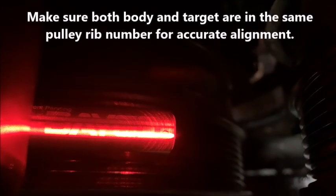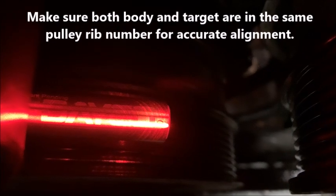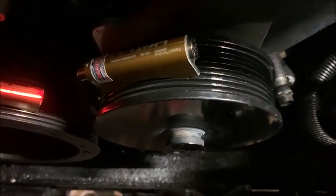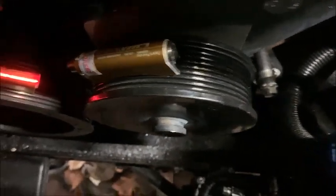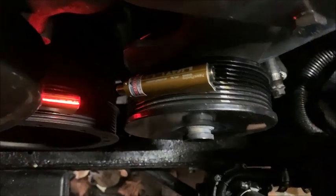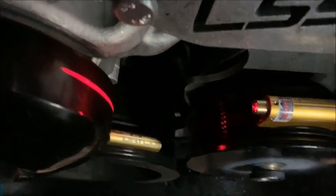You've got the body shining on the target — you can see that groove in the middle of the target. That's what you want to strive for: get that laser right in the center, and then you'll know the balancer and the steering pump pulley are in alignment. Let me get my tool and move the steering pump pulley inward a little — that's exactly the direction I'm going to have to go.